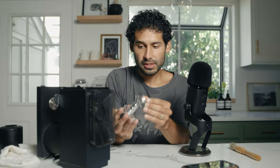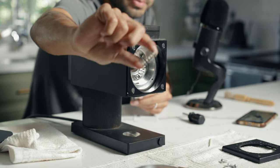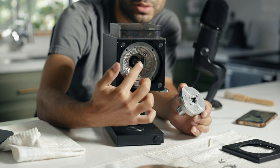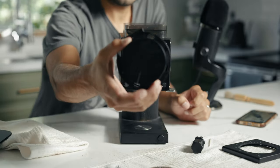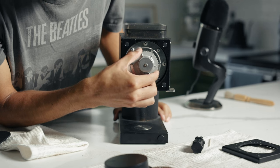Now just grab this piece, stick it on, align the holes. There's a little spring that you want to put inside before you install your burrs. Then we're going to align the auger — you can see there's a horizontal line here, and you want to align it with this horizontal line. Now we just put the screws back on and rotate until you hear the burrs touch. You're gonna hear a noise — right there, did you hear that?